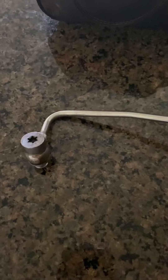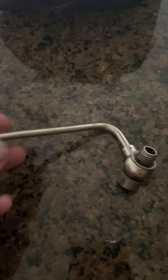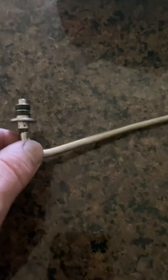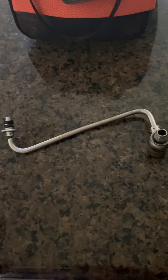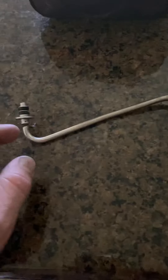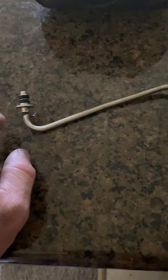This is a video for a 2012 Chevy Cruze 1.4 Turbo. This is the old turbo oil feed line — it was originally on the 2012 model but I got a 2013 in there now. I had a major oil leak, took it to the mechanic shop today, and they told me the only place they see the leak coming from is this part, because he wiped it off, let the car run, and said it was only squirting out where the bolt was.